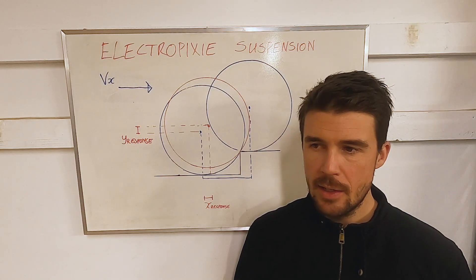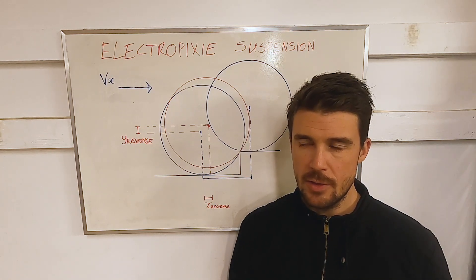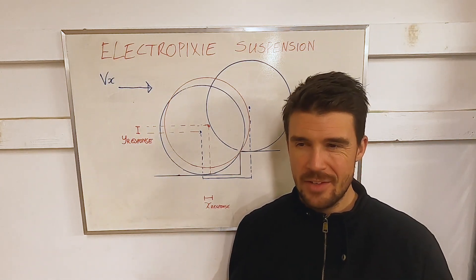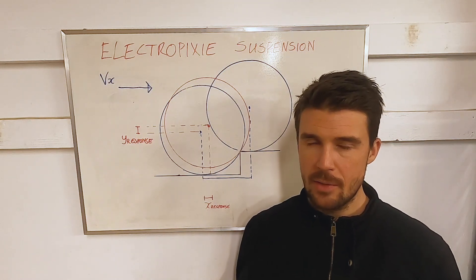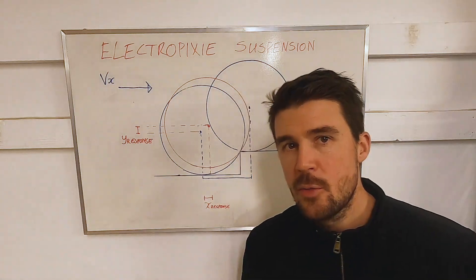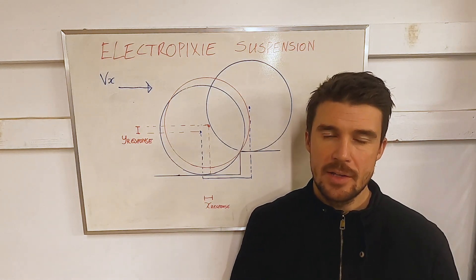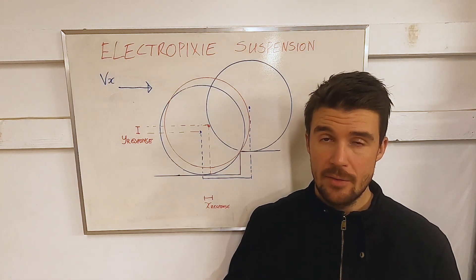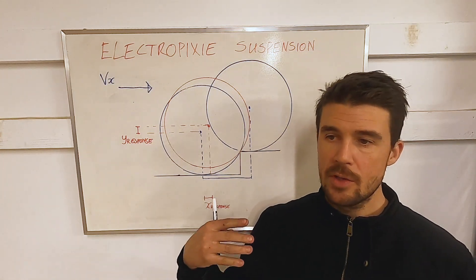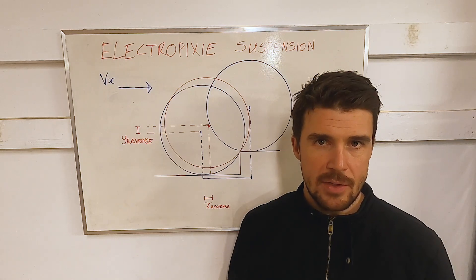What we've seen so far from both Flight Attendant and Live Valve — and what we're likely to see from Ohlins fairly shortly — have been mode selection systems, essentially. Live Valve is a binary system. Flight Attendant is more incremental, but it's still essentially the equivalent of a $2,000 automatic lockout. It's more than that in the case of Flight Attendant, but not too far from it. It's worth noting that when it's in any given mode, it isn't fundamentally different from a purely mechanical damper. Because it doesn't fundamentally alter the mechanism by which damping is generated, or the spring force, or friction, it isn't really a big deviation from what we currently have.